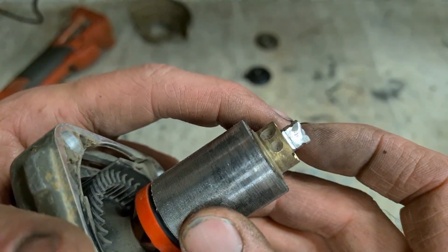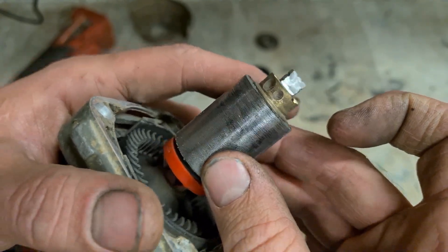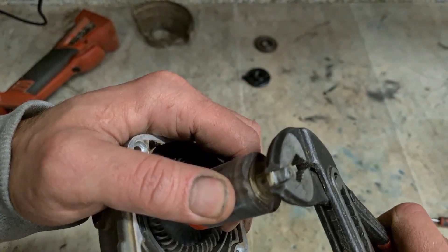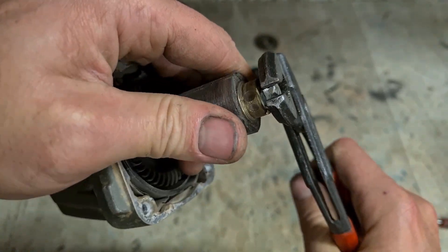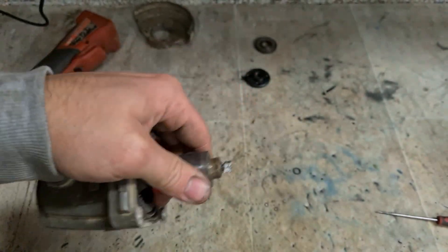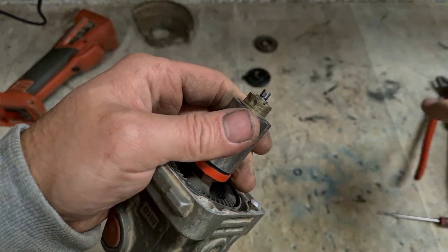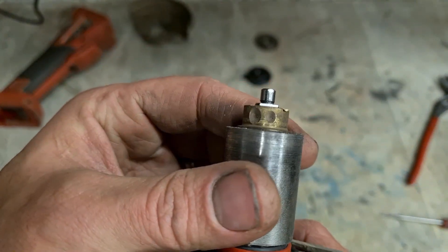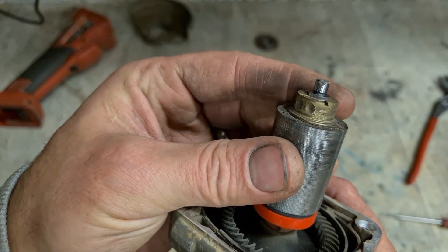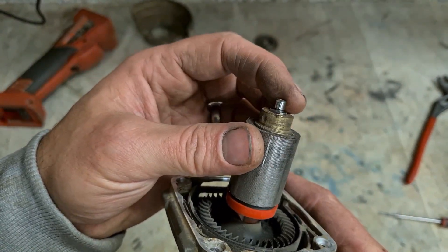As you can see, it's just showing the shaft through that old bearing. Use a pair of pliers or vise grips — or a vise, even better. Give it a pull straight off. On your shaft you might have the tiniest little nick, but that won't affect the bearing — you get the new bearing on and it'll still hold just as tight on that shaft.